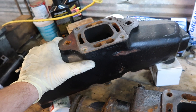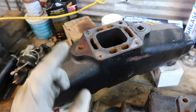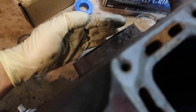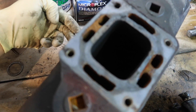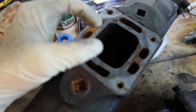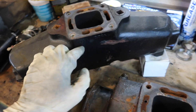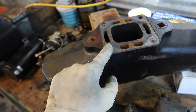What happens is, if they crank over their boat and get a knock, that is water going into your cylinder. Over time, guys will have a really small crack here — this water drips in, and there's nothing holding it back. If water gets into here, that's your cylinder. Water will sit on your exhaust valves, they start rusting, and it doesn't end up good. If you've got a big enough leak, the water will go down through your cylinder, get into your oil, and you can't figure out where it's coming from. A telltale sign: you'll see rust dripping down the outside — that's an external leak, which is the one you want rather than an internal one.